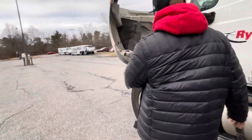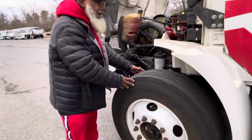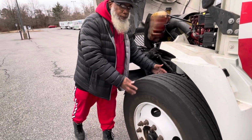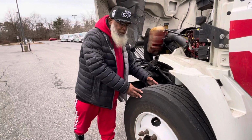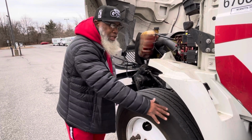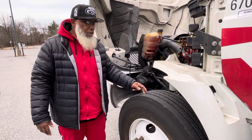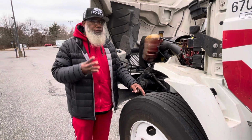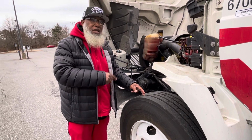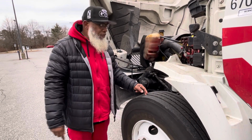Now, the steering tire. The steering tire is not cracked, not broken, and secure, not dry rotted, properly inflated to the manufacturer specification, no cuts or bulges on the sidewalls, tread is evenly worn, the tread should be no less than 4/32 in tread depth, and the front steering tire cannot be recapped. All other tires can be recapped.